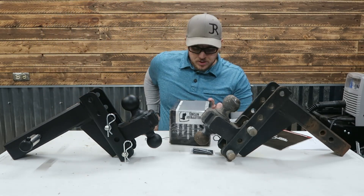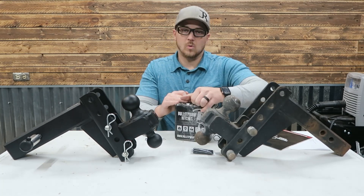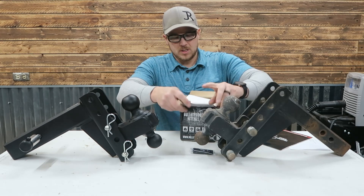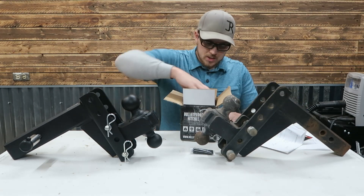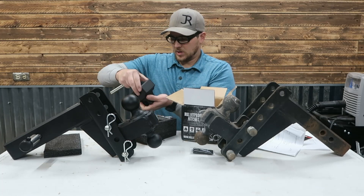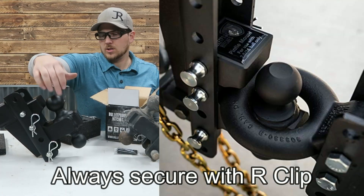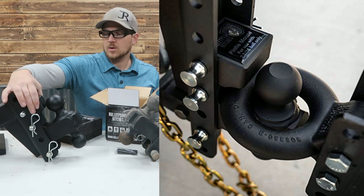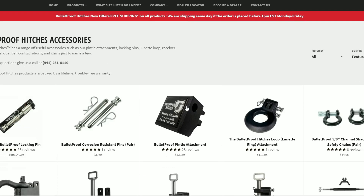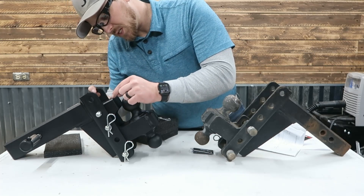There's another extra treat here — not as heavy. Any guesses what this is? With the landscaping business, we don't have one of these yet, but one of these days we might get a dump truck. Having the ability to put a pintle on here is awesome. This just sets right on the pin, and then the top pin goes on, your lunette ring goes through, locks it into place — boom, you're ready to go. Really cool features. We've got a pintle mount for use with the two and five sixteenths inch ball only.